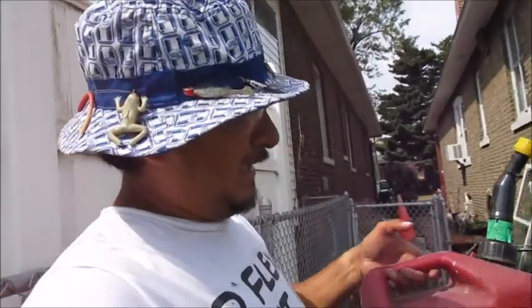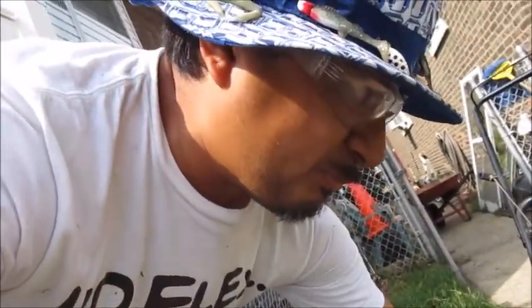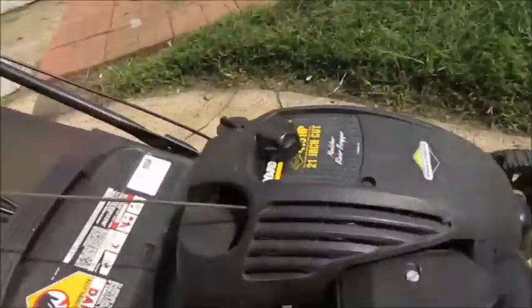When I fill up my lawnmower, I cut the front yard and I know there's gas left, but I'm topping it off anyway. I keep a gallon of premium gas right here. These carburetors have very tiny pieces and holes, so use premium gas so you don't gum it up. If you run out of gas, you suck dirt from the bottom into the carburetor. At the end of the season, I don't run the gas all the way out — I add Sta-bil, fill it all the way up, run it so the Sta-bil gets through the whole fuel system, then top it off again with premium gas.